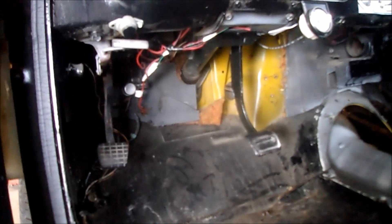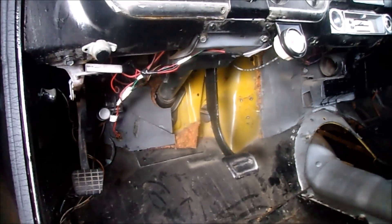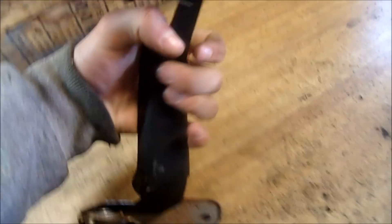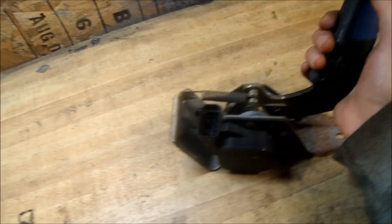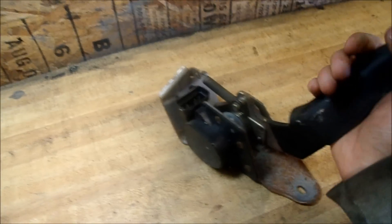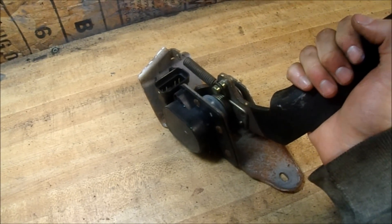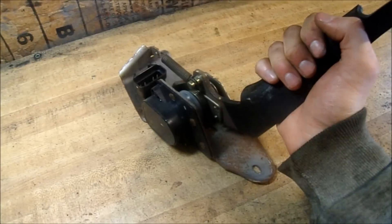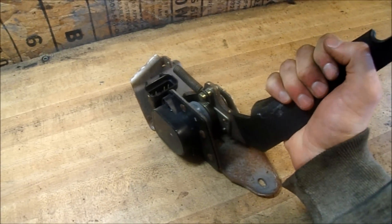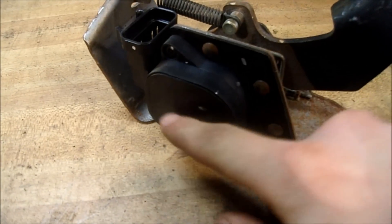There's room right there in that yellow area — that should be enough room to mount it. Not a lot of people run drive-by-wire. I'm just running it because it was already on there. It's more work to change over to drive-by-cable because you have to add some pins to the computer and a bunch of stuff. Once I get the computer tuned up for the Turbo 400, you won't even realize it's drive-by-wire — you can't tell the difference.